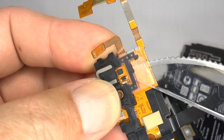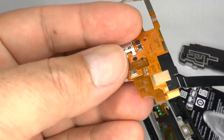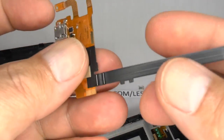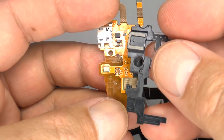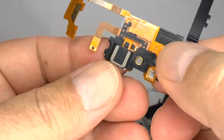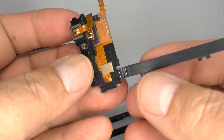A new USB board will be flat, so you'll need to put a slight bend in the cable where the white lines are and replace that plastic spacer. Then place the notification LED back onto that small locating pin, and you can reassemble from this stage.